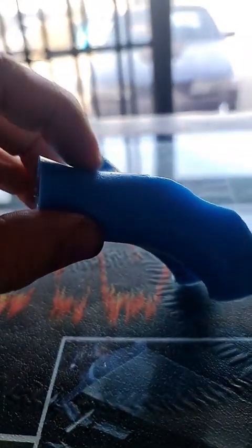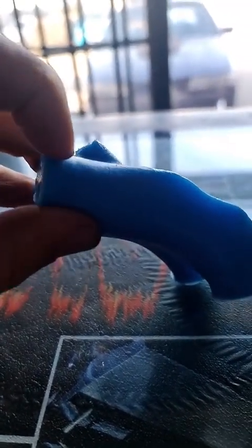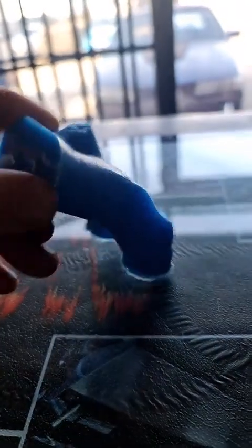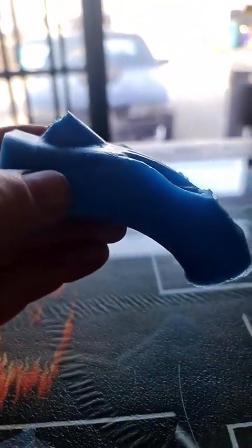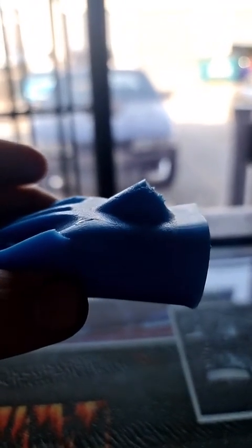Now the core shift - as you can see from here to here it's a lot smoother. This is actually the same seat section, and they've done the same with the bowl - they'll come in and plunge the actual seat and throat area, and same with the window. But this port mould was actually low - we get what we call core shift, so this plug might have been down a little bit. You can look across a six or four cylinder head and you'll see it. The mould was actually back a little bit, so it really needed to be forward more so it lines up with the actual throats. You can see that gap there - we've got to blend that in and create a better transition. On the top side they had to bring the window up because the mould was actually down a little bit. So when we port this, we'll take a straight line from here to here - that'll increase the cross-sectional area and balance that up.